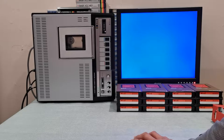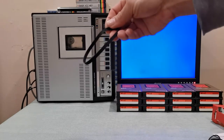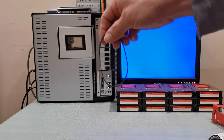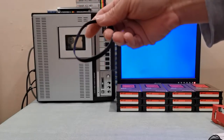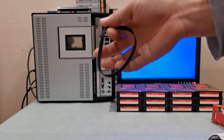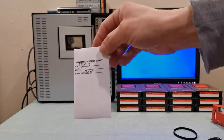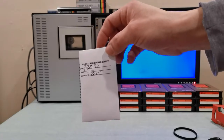The 8200 model machine I have not been able to get up and running — I'm still working on it. But the good thing is that I was able to make this 8400 work. I had to change the belt — right here is the capstan belt. I bought this online. I actually purchased two, one for this machine and another for my older machine. This is a brand new belt, a replacement for the original 1976 belt from Elliott Electronic Supply, model FBM 9.4.